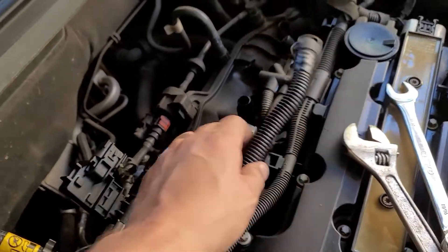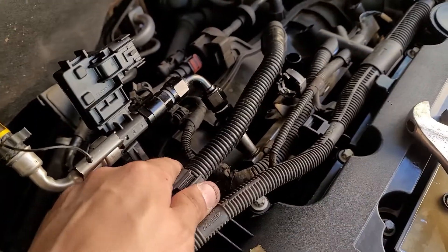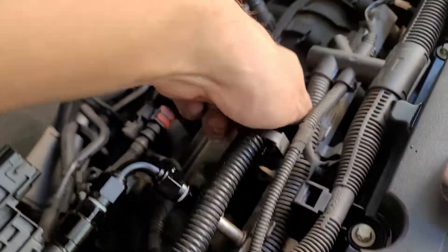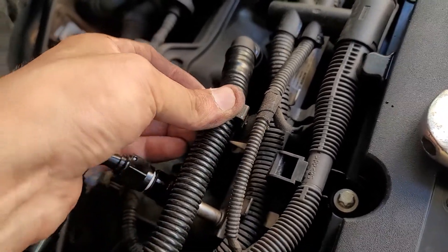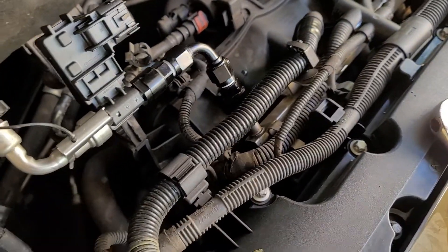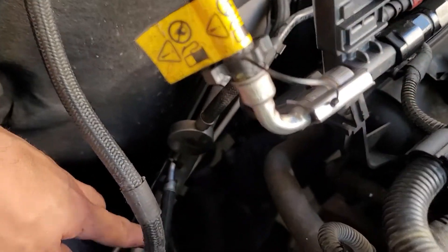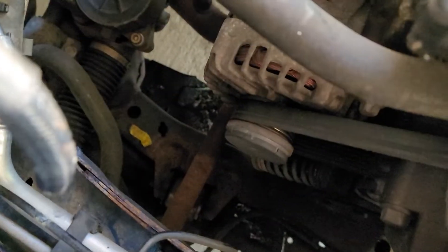To reach it I removed this hose, but I could have done it a different way — we're already going to have to take off the fuel rail to put in the injectors, so I could have just taken out the fuel rail; it would have been easier to get to. One last thing: this is the routing for the fuel line — I zip-tied it here to the AC line so it stays out of the way. You don't want it accidentally hitting the belt.